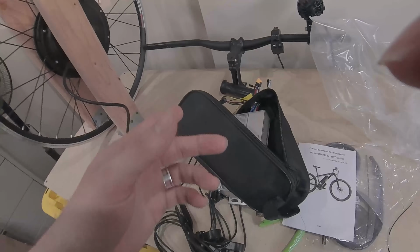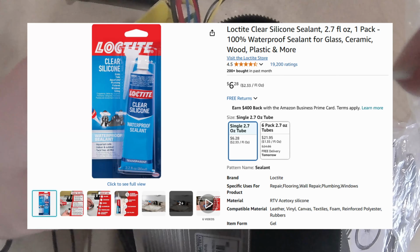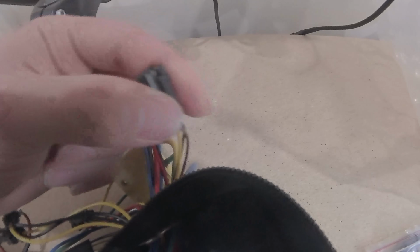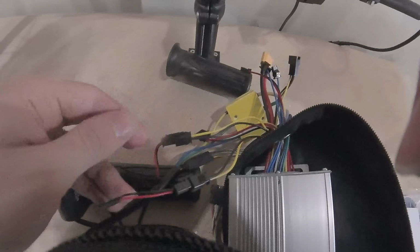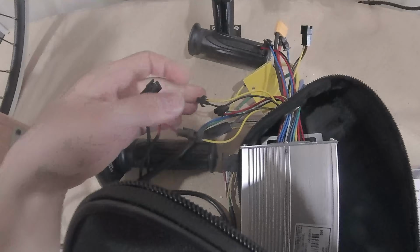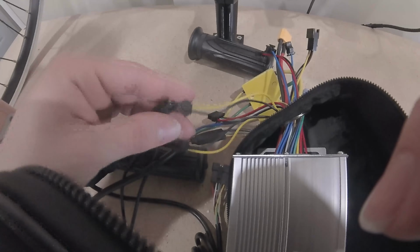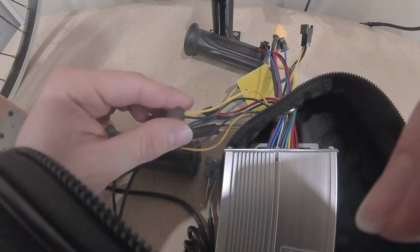So what I recommend if you get this kit and you want a simple way of waterproofing it, take some of that Loctite silicone, I'll link it down in the description, and just coat all of these connectors down here so that this is completely sealed. Same thing goes for the back of these connectors. Just put some silicone on the back of all these connectors. If you're not using the connector, tuck it in the bag. And then when you plug the connector in, and this last step is a little bit overkill, but use dielectric grease, put it on the outside of this here, and then slide it into the other connector. The dielectric grease will just coat the outside of the connector and create a pretty good seal, preventing any water from getting in and corroding those terminals.